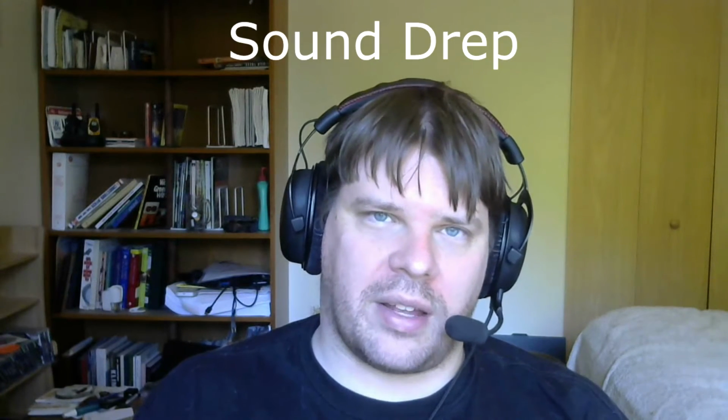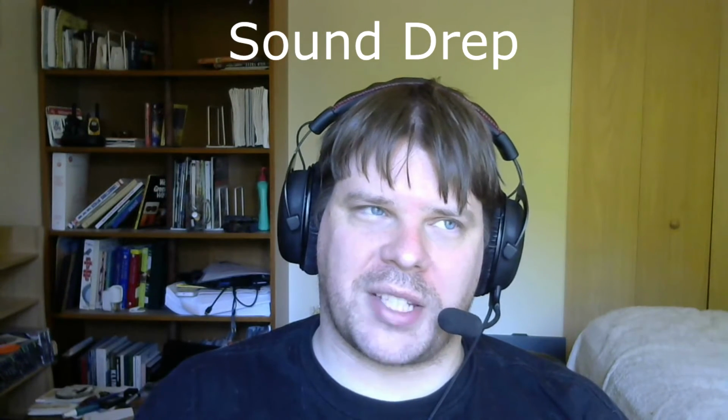The other 2 I did: I did a sound level test. I do have a decibel meter, and I put the microphone 2 inches in front of the fan blades to see how much noise they would make. The ambient room noise was around 25 decibels, so extremely quiet. There's not much noise or anything going on. I made sure that if the grandfather clock or something like that went off, I wasn't testing at that point in time. And the other thing was the RPM range.